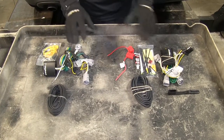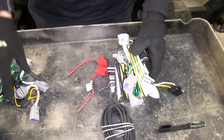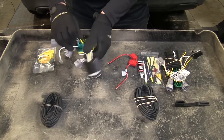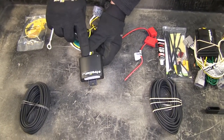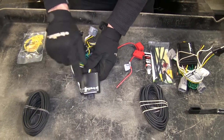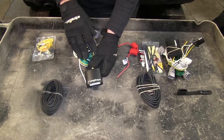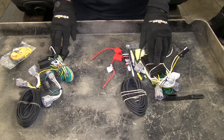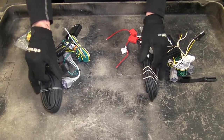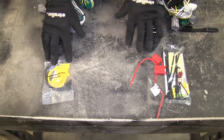Now let's cover some of the details that apply to both products. You'll notice they have these connection points right here — they plug in right behind the factory tail light, so our connection points are going to be the same. They both have these modules, which take the signal from your vehicle, copy the signal, and using battery power send it out to your trailer. That way all your battery power is working on the trailer and it's not putting any stress on the electrical system of your vehicle. Either one of these will protect your Jeep from a short on the trailer. Since both systems use battery power, they both come with a generous amount of wire to run from the modules up to the battery, and each kit comes with a fuse holder and all the hardware you need to install it.